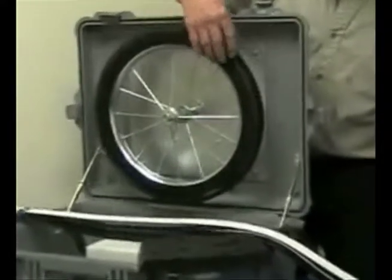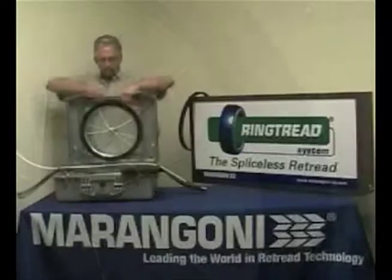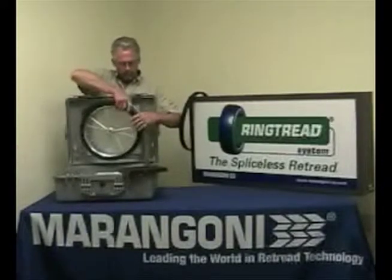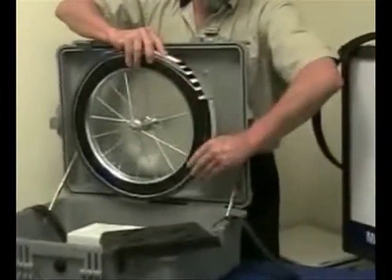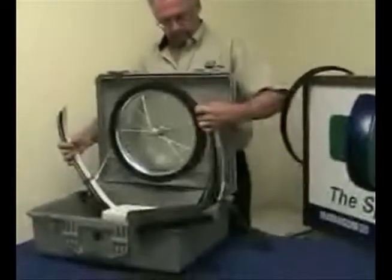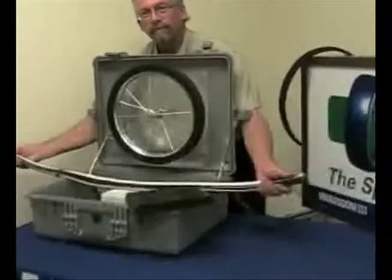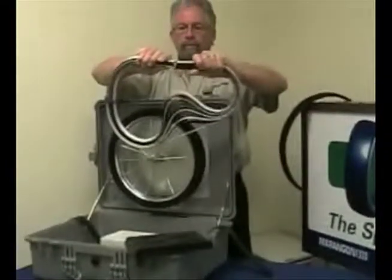I have built this display to help demonstrate the problems encountered when you take a piece of tread that has been molded flat and try to wrap it around a casing. In conventional pre-cure retreading, you buff a tire to remove the old tread and prepare a proper surface on which to bond the new tread rubber. You measure the buff circumference and cut a piece of tread rubber to that length. I have stacked these strips of rubber to correspond to the thickness of a typical piece of pre-cure tread rubber. One end is attached to the surface of the casing and the tread is wrapped around to form a splice. The upper layers of this piece of tread must be stretched dramatically to accomplish a proper splice. No matter how you trim the ends of this tread rubber, you will still have the problem of uneven distribution of the tread around the casing. In order to force these tread ends to meet in a splice, you must absorb this many cubic inches of displacement within the piece of tread rubber being applied to this casing. This requires a lot of stretching and then crowding at the splice to make good contact between the two ends.